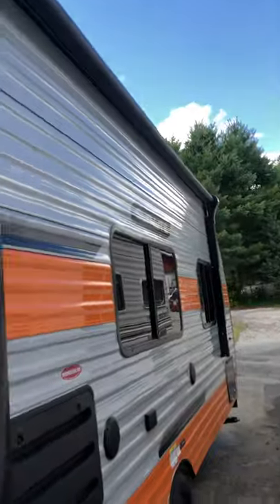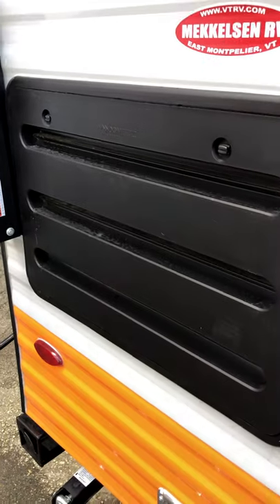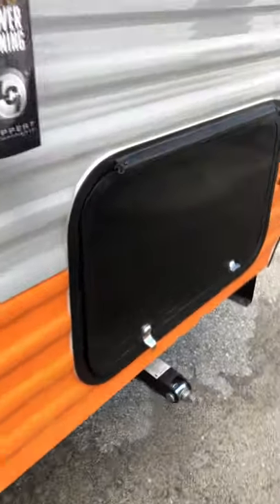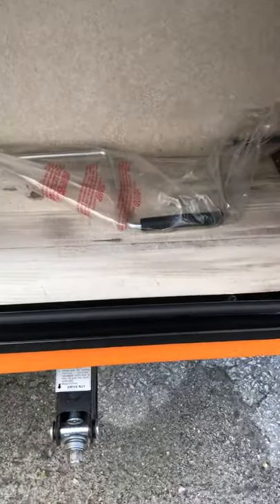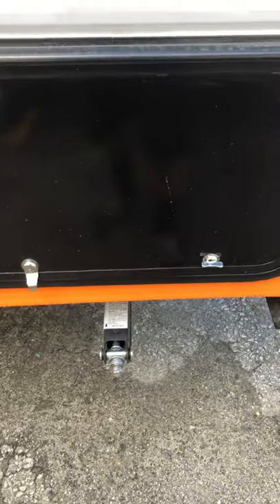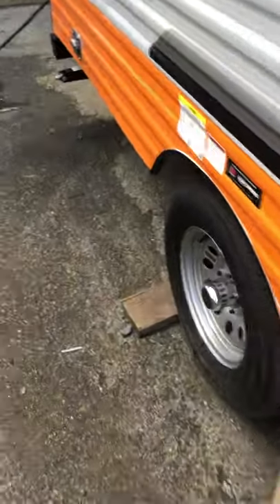You also have another awning on the side. Then you have a vent right here — this is for the back of your fridge; you'll never have to go back there, it's just where they service it. You have a couple speakers out here and an outlet right here. Then you have another front little storage compartment right here, and that is a crank for your stabilizer jacks. It's a three-quarter inch nut, so you could use a three-quarter inch socket with a drill to make it quicker — just be careful when you're doing that.